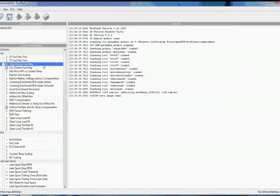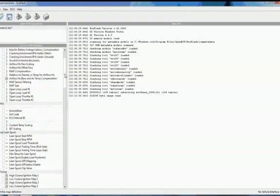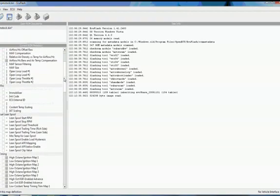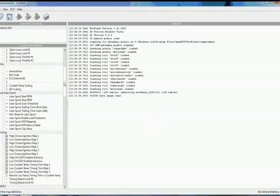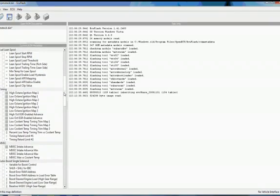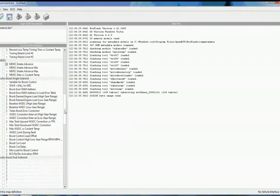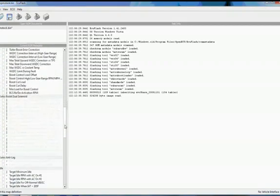So now that we've taken a look at a fuel map, we can just go through and look at some of the other basic attributes that an ECU image has from the Evo. As you can see, they're broken up into categories for organizational purposes. You can see we have timing maps. On the Evo 9 we've got MIVEC cam and intake advanced maps.